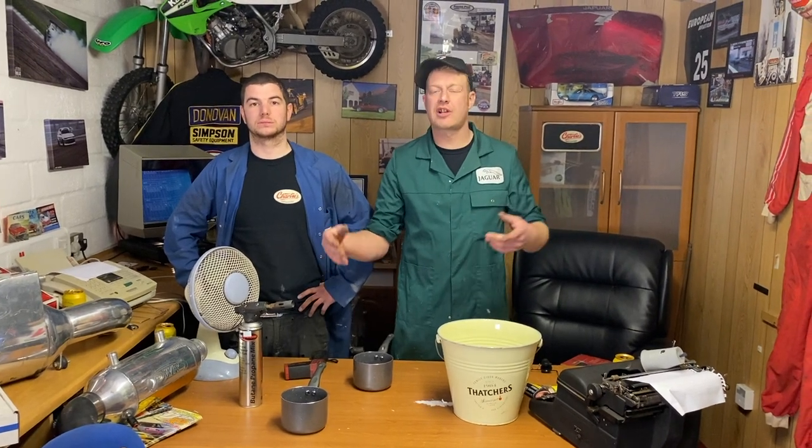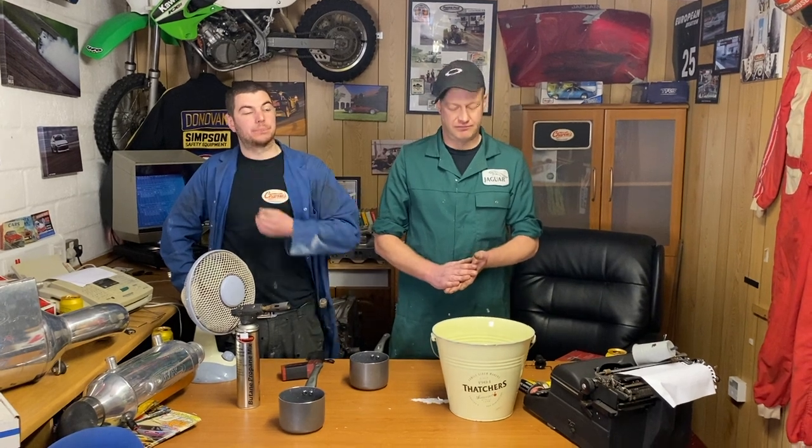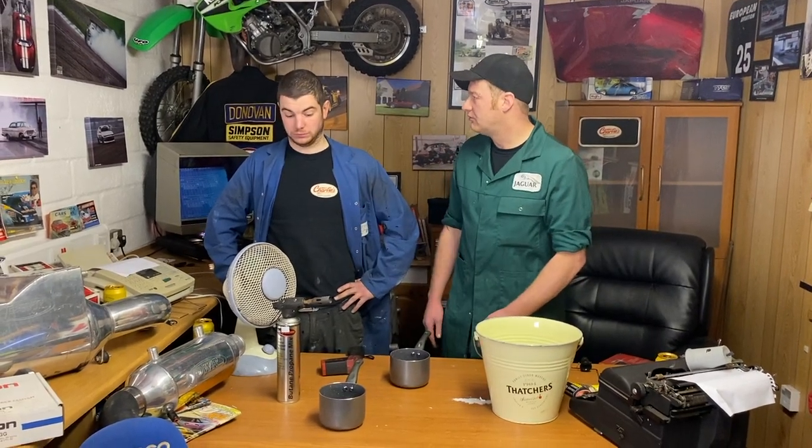A lot of people say, why don't you use methanol in your charge cooler? It's closed loop, it'll be fine. Few reasons. Number one, you have a knock. You bust the line. Yeah, it's closed loop, nothing to do with the engine itself. But you hit the car, you're going to blow methanol all across the motor. And we've got a turbo and a hot manifold. You're going up in flames.